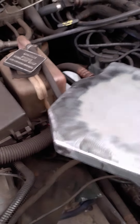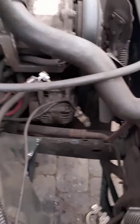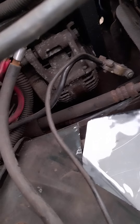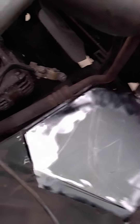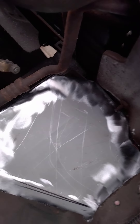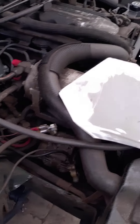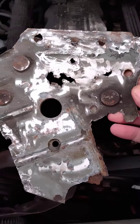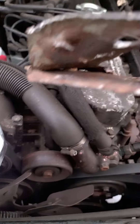The new plate fits reasonably well. It's going to be welded in here, but the most difficult thing is to make the reinforcement plate of the battery tray. It's 2mm and it's completely shot, as you can see.